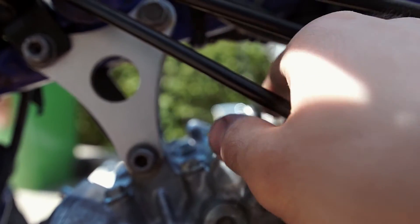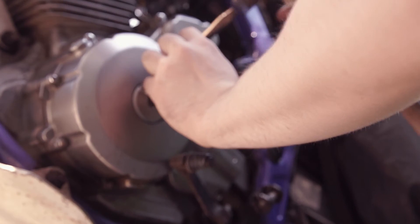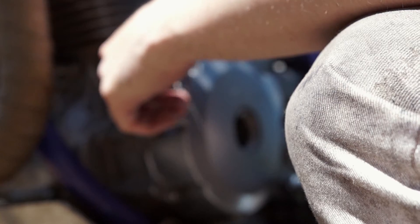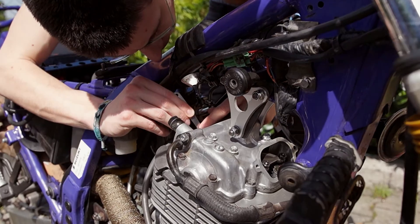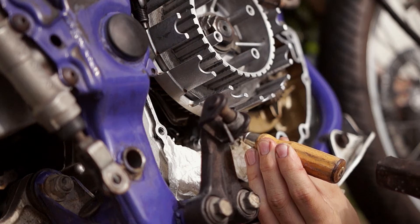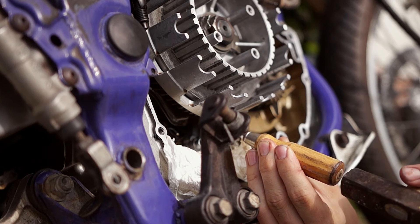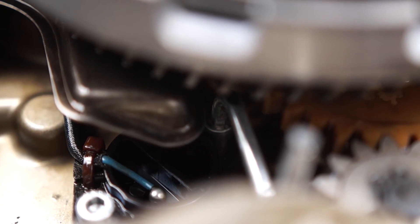I decided to adjust the valves as it's so easy with just two valves and two locknuts. Unfortunately I had lots of problems with overly tight screws and caps — I used a handy technique and it worked perfectly. Finally I was able to turn over the engine and position it at top dead center. I took off the old oil cap and opened the left engine case. I wasn't able to remove the clutch basket, so I hammered loose the old neutral safety unit screws that are known to fall out in some engines. I made a tool and replaced and Loctited the screws down with new allen screws.